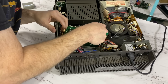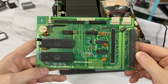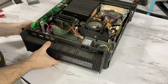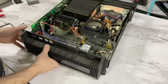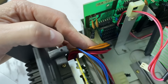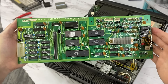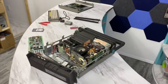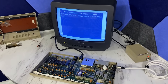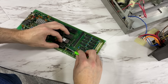This little board is the I/O board, which has the two 6526 interface adapters on it. I don't think it's likely that either of these is the problem, but I can't rule it out just yet. The entire back piece of the computer is essentially the power supply, which I had to remove so I could reach this plug. Now I can finally remove the CPU board — this is basically the Commodore 64 part of the computer and has most of the same chips. The way I'm going to test this is I have a regular breadbin Commodore 64 setup that's fully working, and I'm going to remove these chips one at a time and try them in the regular C64 to see what happens.